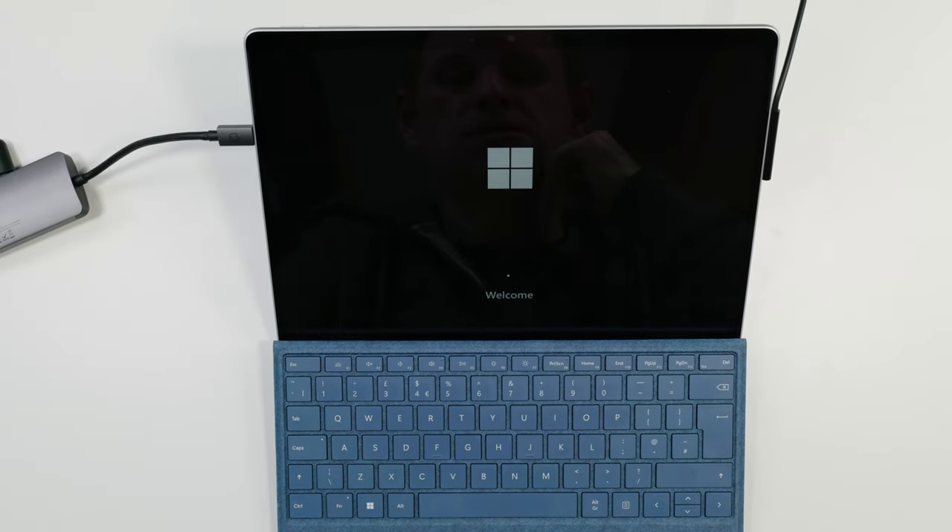When it comes to the upgrade process itself, it was, as expected, pretty straightforward — perhaps a little bit fiddly swapping the drive over, but nothing too taxing. The software side, swapping the Windows installation and doing the recovery drive, is something most people would be able to do if they follow the instructions on Microsoft's website. All that's left is to reload all my apps and get the Surface Pro set up the way I want it — with all that extra space to play with. I think it's great that Microsoft allow you to upgrade the SSD in these devices. Wouldn't it be fantastic if Apple did the same with the iPad and Mac? Let me know in the comments and I'll see you next time for some more Geekery.